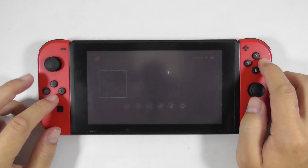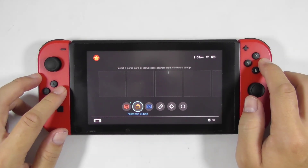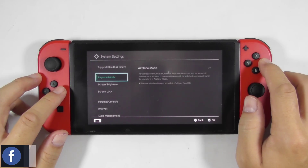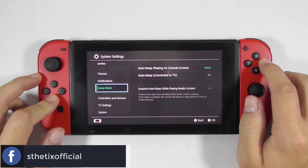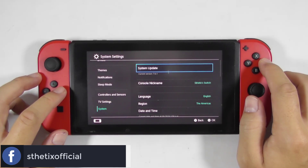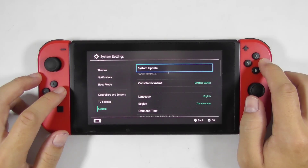As I made this video, the latest Nintendo Switch firmware is on 8.0 and you cannot install any custom firmware on this version right now. If you have accidentally updated your console to 8.0 without any NAND backup, then you cannot do anything — please wait for further information. But if you do have a NAND backup, then you can roll back to firmware 7.0 or 7.0.1. I will make that guide later on. But in this video, I will show you how to cancel the update and delete the downloaded firmware on your console.